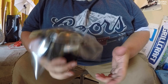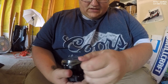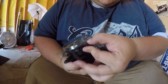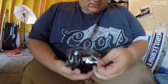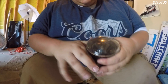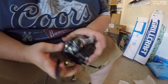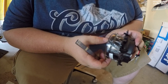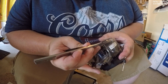With this 3M clear bra material, you're supposed to do a wet application, but we don't feel like doing that and I don't think it's really necessary here. Since we're only wrapping it right at the edge of the glass, we can stretch out any wrinkles that get in it. Just stick it down around the edges, then put the knife out and cut the excess. This stuff is really thick — probably three times as thick as normal vinyl wrap — even a brand new razor is not wanting to cut all the way through. But it's very strong, which is a good thing.